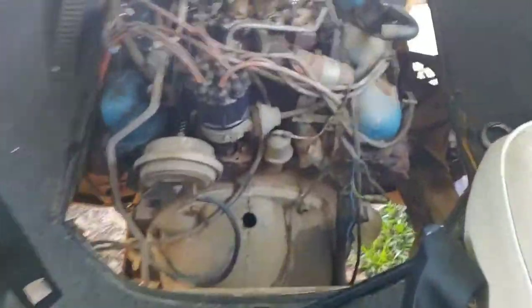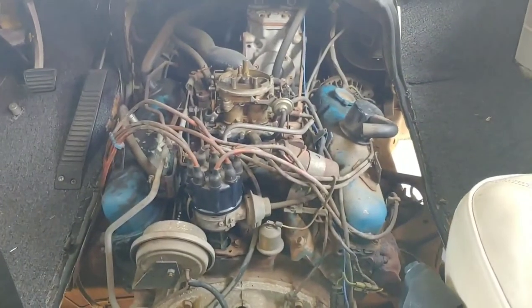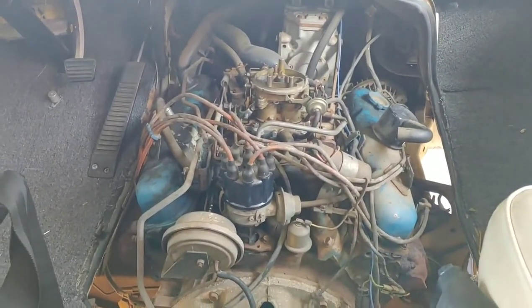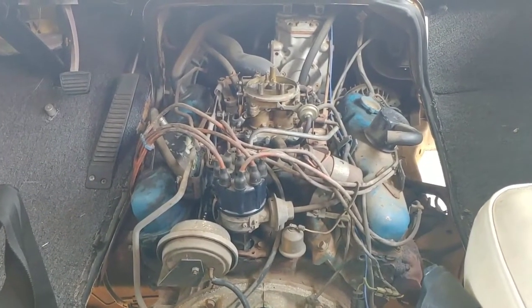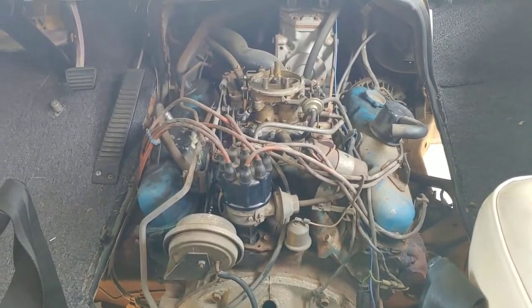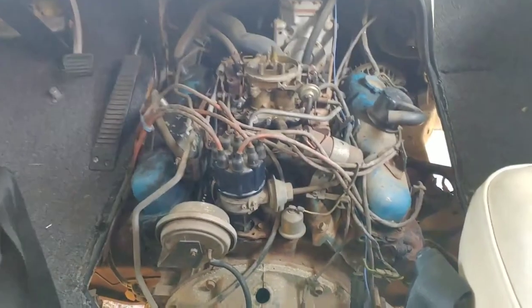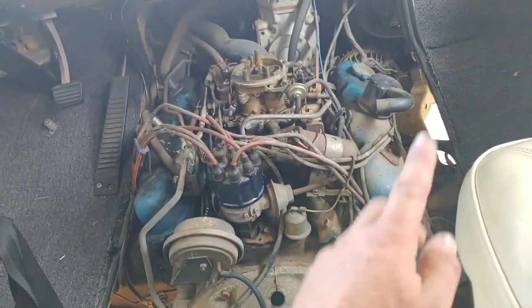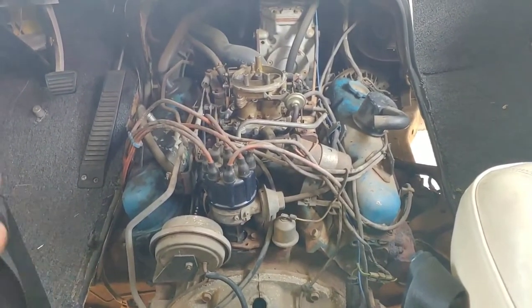And yeah, got the engine cover off so you can get a look at this guy. This is a Mopar 360. I rebuilt the carburetor, and it needs a little bit of fine tuning. And I got a carburetor guru himself, Steven, coming over, and he's going to put his magic ears on it. I got it close, but it still kind of lags when you give it too much all at once. But other than that, found out it's got a cracked exhaust manifold, typical. And I got a line on some long tube headers for it. So a little more power, a little more fuel economy.